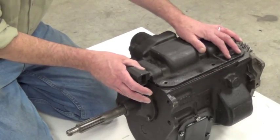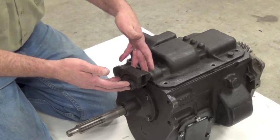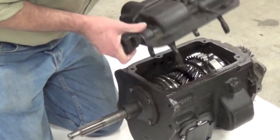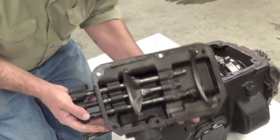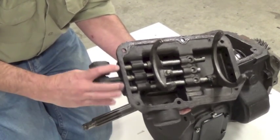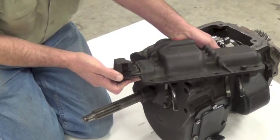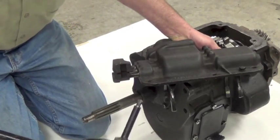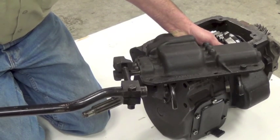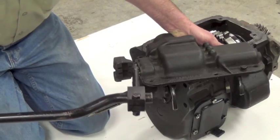This is the top cover for the T98 4-speed. The three shift rails inside the top cover protrude out the front, and three shift levers are attached to those. The three separate brackets create a rectangle on the end, and in that rectangle is where the shift lever ends up to move. When you move the cab shifter left and right, it moves up and down. When you move the cab shifter back and forth, it pulls or pushes these levers.